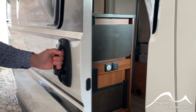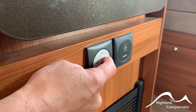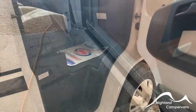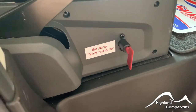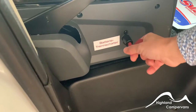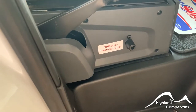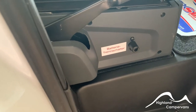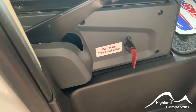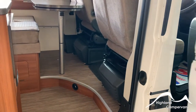Open the sliding door and just inside you've got your step switch — a straightforward open and closing action to make the step go in and out. Critical to the whole operation of the 12 volt system in the back of your motorhome is this isolator switch here. You can remove the key altogether — if you do so, your 12 volt system is completely switched off in the back. When driving, there is no longer a relationship between the engine battery and the leisure battery for recharging. 99% of the time you'll have the key locked into position so that you've got the relationship between the two systems.